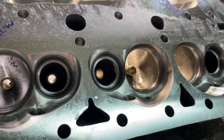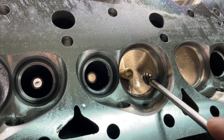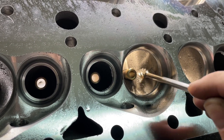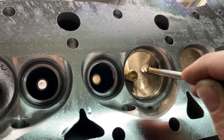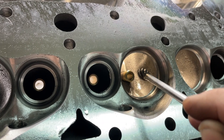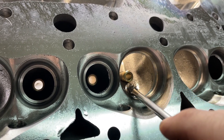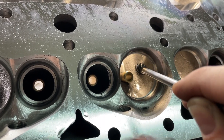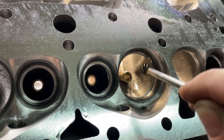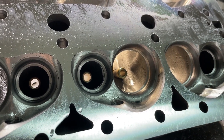That assault head is a copy of the Dart head, but to differentiate it they put a bulge right there in the bowl area. The bowl should be rounded, and having that bulge means you'll end up digging in and won't get that round shape. So before shaping the bowl, grind that bulge down so the shape is consistent through there. You're not making it larger at that point — just grinding the bulge so it's the same curve. Otherwise you'll naturally follow the bulge when grinding.